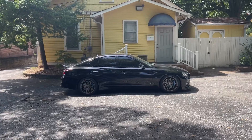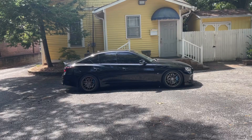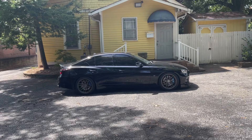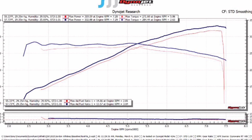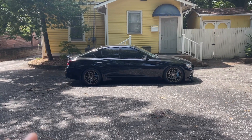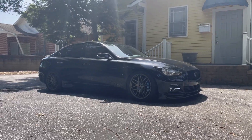I had a great opportunity recently to test this theory at Soho Motorsports on their dyno. This car has made some decent numbers with simple drop-in filters and an aftermarket custom cat-back exhaust. Paired with two and a half inch test pipes, I first made 333 horsepower and 284 foot-pounds of torque — some of the highest torque numbers I've seen on this platform. Those numbers were achieved with two and a half inch test pipes but a two and a quarter inch cat-back system.